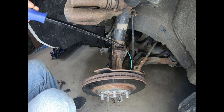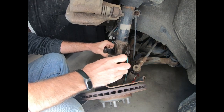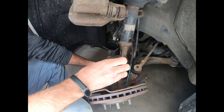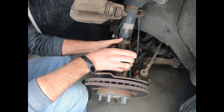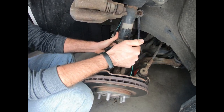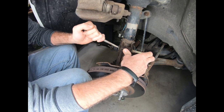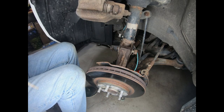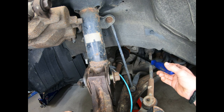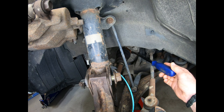You may or may not need to come in with a pry bar and pry this part of the spindle out of the bottom side of the strut. And just like that, we're out. So the next thing I'm going to do is put this back together and slide a bolt back in there just so it can support itself and we're not stretching the heck out of the wheel speed sensor wire. The next step will be going underneath with an angled pry bar right in the back side just underneath the axle, and weaseling it up through the subframe to pry and pop it out of there.